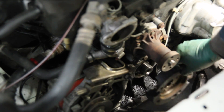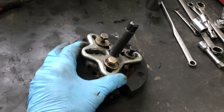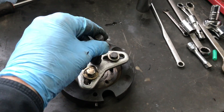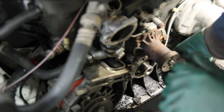You're going to start out by having to remove the counterbalance pulley, and the only way you can get this off is with a puller. It's not an expensive puller, but most people don't have one. We do carry it on my website, or you can rent these type of pullers from a tool rental place. Then the next thing you need to do is pull off the old seal.